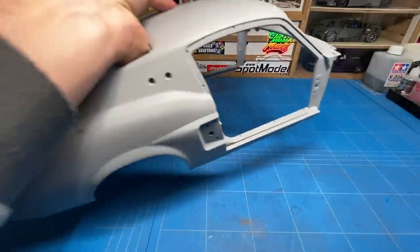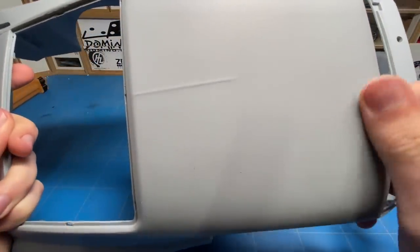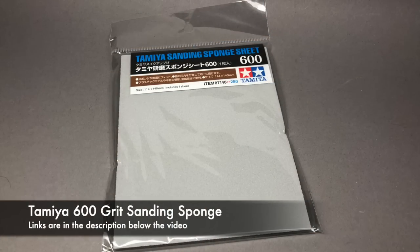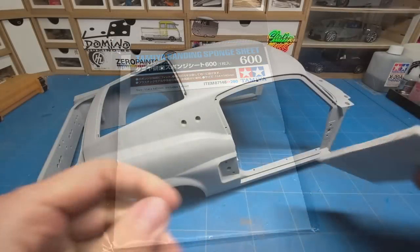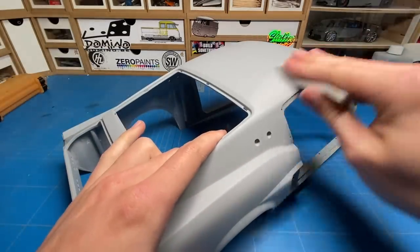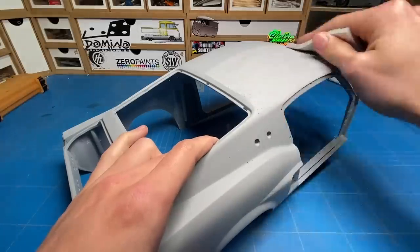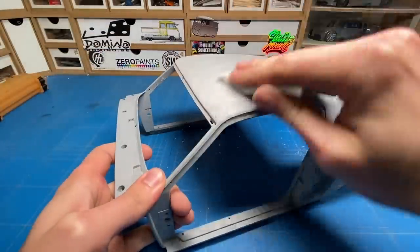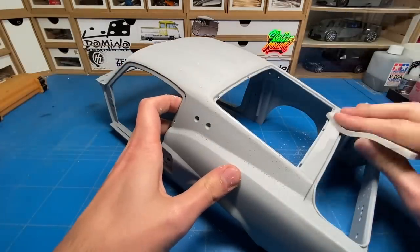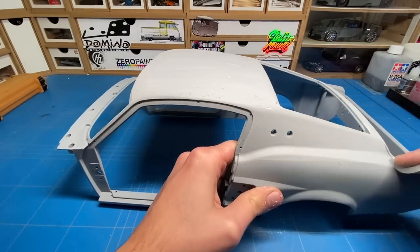The body was pretty smooth after the first sanding session, and with the primer on it still looked nice and smooth without showing all that many imperfections. There were still a couple of rougher sanding scratches from the 400 grit but nothing out of the ordinary. So I decided to sand it down with a 600 grit to refine those rougher scratches, smooth out any dust spots, and generally smooth over the entire primer so the paint would have a very nice surface to lay on top of.